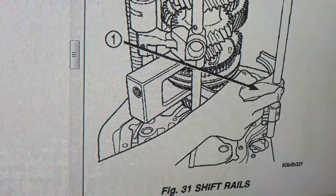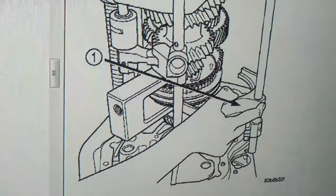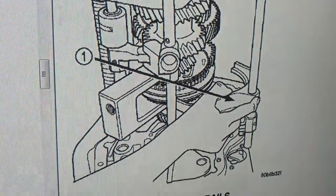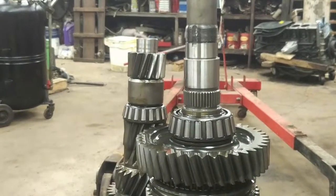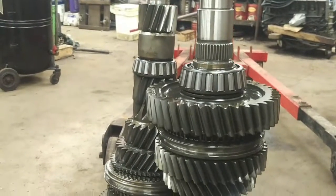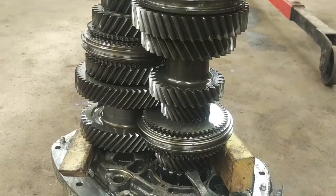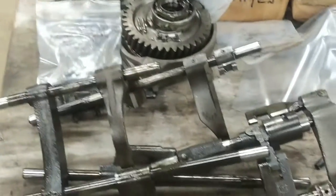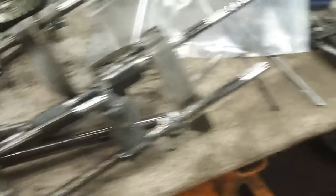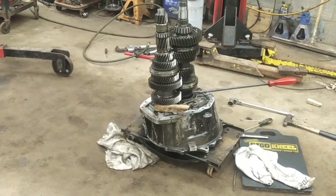They show a tool to hold the 5-6 synchronizer together so it doesn't come apart when you lift the assembly. The service manual procedure says to use a fixture to raise the counter shaft and main shaft about an inch out of the housing so you can pull the shift forks and shift rails out. I figured if I just lift it up from the bottom and block it up with a block of wood on both the main shaft and the counter shaft, I should be able to get those rails out — and I've done that. It's a jigsaw puzzle, but the shift rails are all out. We're going to continue disassembling the transmission main and counter shaft to change the synchros.